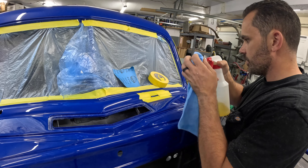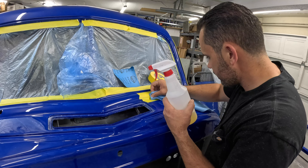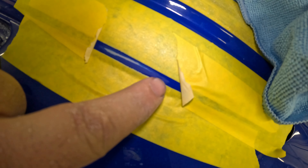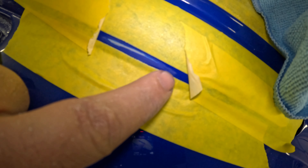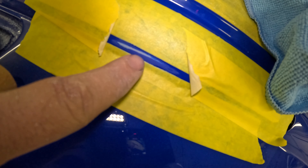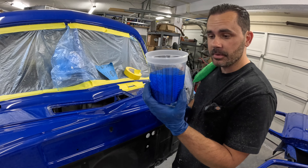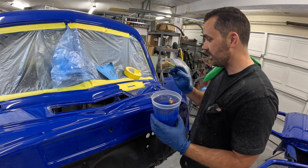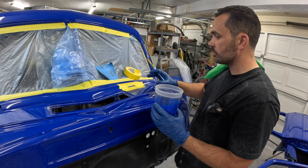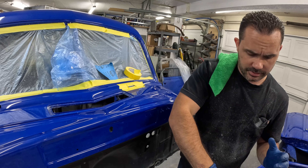I've sanded it and I have some good news. Let me wipe some grease remover real quick because we need a clean area. That's how it came out. One of the two little parts actually sanded out and there's still base — so I'm not going to put any more color in that, I'll just end up clearing a little bit over it. I'll come in here and put a little bit of base in the other spot. I picked up some base — it's only about three ounces, way more than I need, but about the smallest I could mix up. I wanted to make a 2-to-1 mix exactly the same as what's on here so hopefully the color looks the same. It's in there, nice and mixed up. I'm going to kind of paint it in.